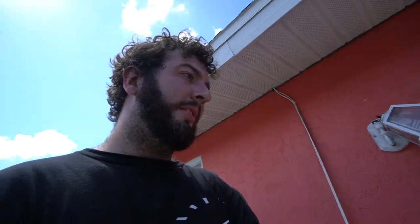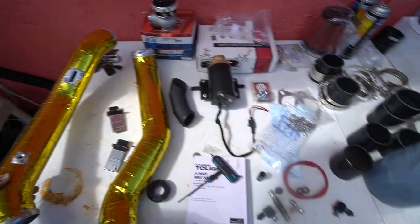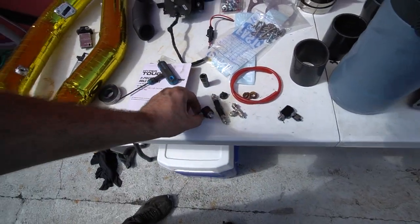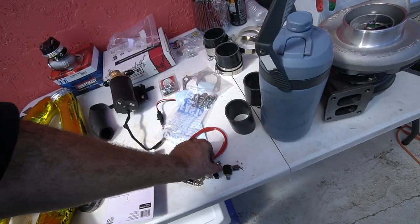We got nuts and bolts for mounting the methanol tank in the trunk. For now I'm going to get to putting the MAP sensors and the methanol injectors into the intakes — putting dual number-three injectors in here so there's enough methanol for him and it won't drain the tank too quickly.